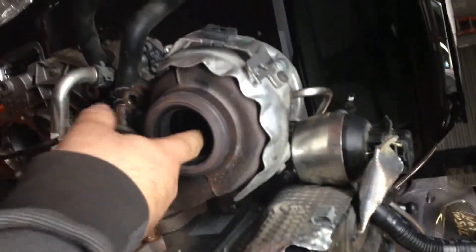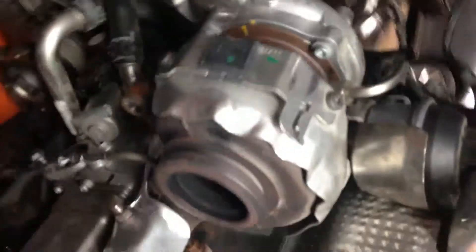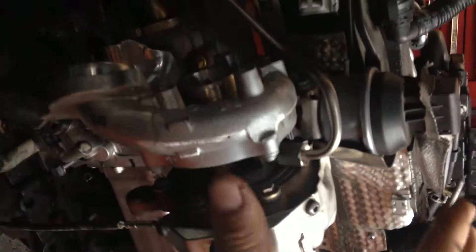The reason why we pulled it is the turbo — the old turbo. The internals froze up, the cartridge. A lot of people don't show you this, but there's a nut which is hard to see right here on the end, and when the turbo freezes, it freezes at such an extreme rate of speed that this nut will unspool itself and go into the motor.